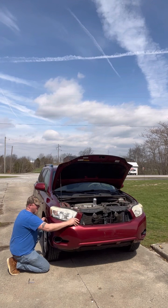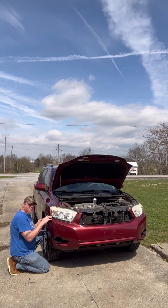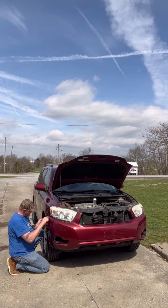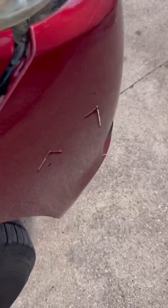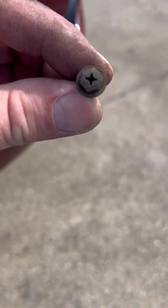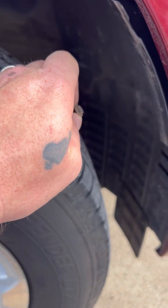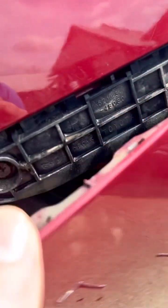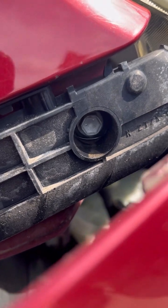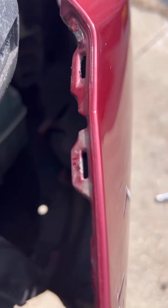Lift, pop — see, it just rolls forward, and it's just enough to get back here. I'm going to show you that clip that the bumper cover snaps into; it's actually bolted onto the fender. It's a black piece of ABS plastic that has slots in the top that the bumper cover slides up and over with some little tabs. These screws are 8mm head but they also have a Phillips. You can start the vehicle, turn the wheel inboard, and then you can get a drill in there — but put it on a low setting or you'll eat the head right out.